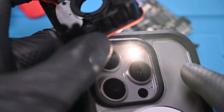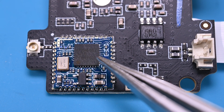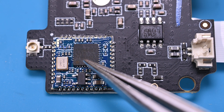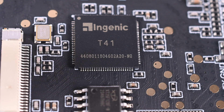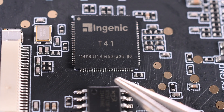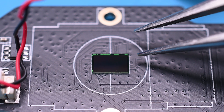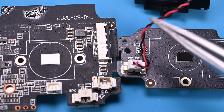So let's take a closer look at these boards. This is the tiny module attached to the top board — the ATBM6062 is a Wi-Fi module, and the small gold component next to it is a crystal oscillator. The eight-legged IC to the right is an audio amplifier. The V4 is using the upgraded Ingenic T41 chip compared to the previous T31 in the V3. The image sensor is truly tiny yet packs 2.5K resolution — compared to the V3, it's actually slightly smaller even. The technology keeps improving.